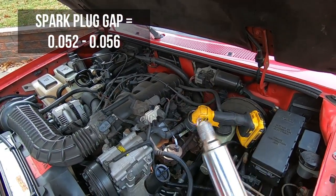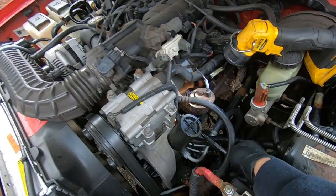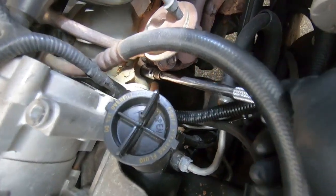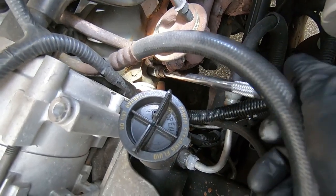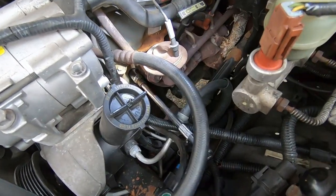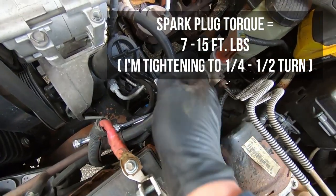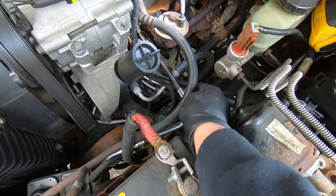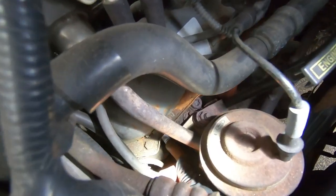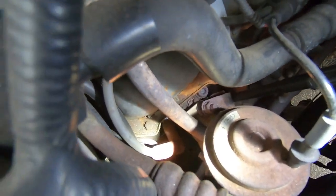Same deal as we've been doing — check the gap, everything is good, this was about 56, and I got a little bit of anti-seize on there. Guiding this thing in — yep, got it in. Going to get that thing to catch, finger threading this in, and then snug this one in as well. That is finger tight — get the socket wrench on there, just give it a nice little turn tight. Barely a half turn, and that's nice and tight. Pulled this off, and got the wire on, sneaking under the power steering line, press that wire right back onto the plug.